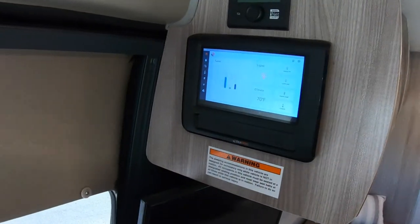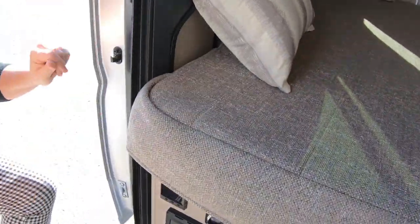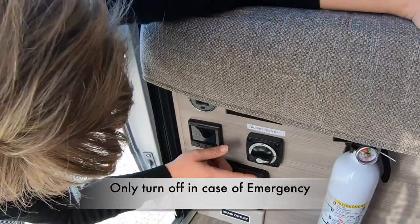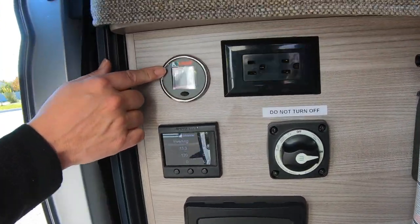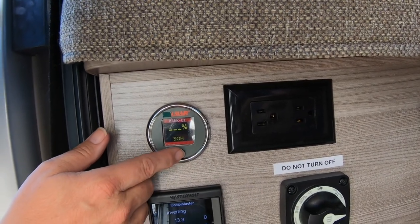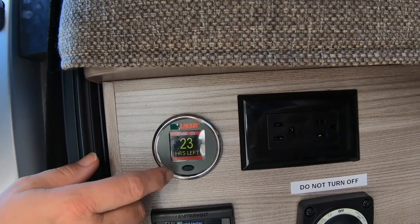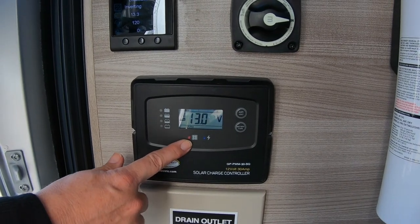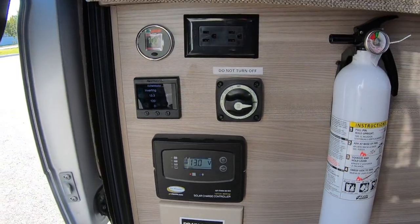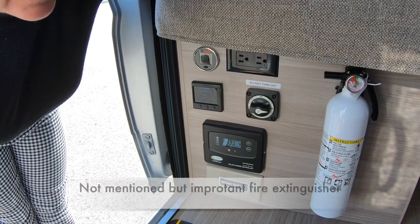Back to the homepage to see the main display. You should never turn this main power off — this is your main power, and if you turn it off you won't have any power to the unit. This little button right here will tell you the state of the battery. Cycling through it will tell you how many hours you have left, the amps that you're using, and the volts that are available — we have 23 hours left of battery. This is the inverter — you should not have to touch that. This shows you when the solar panel is working. If you are parking it and want the solar panels to recharge without using the car, you will need to park it where it's not shaded. The solar panel on the roof has to see the sun or it doesn't work.